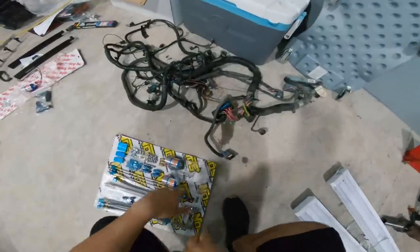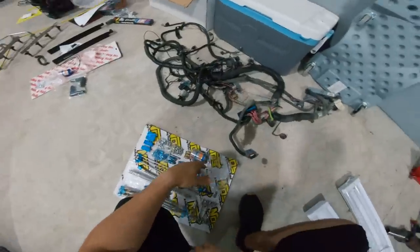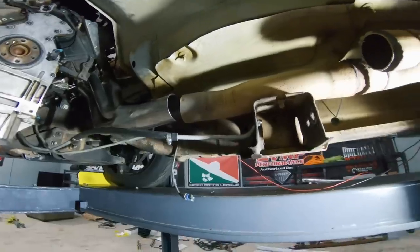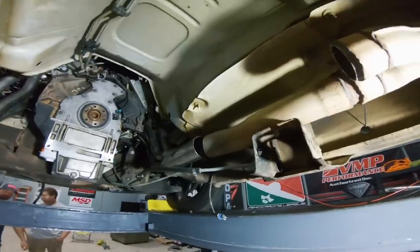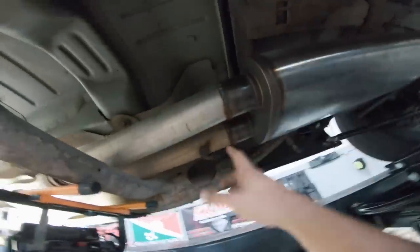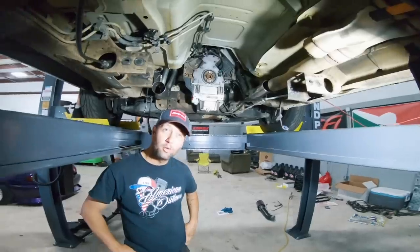Harry also yanked out the entire stock wire harness completely out of the truck. We're waiting on a few more harnesses to come in for the Holley stuff, and once those arrive we'll install the new harness along with the Holley EFI ECU. We'll also need to fab up some exhaust solution, because we've got a Y-pipe coming from the two headers down to a single pipe, but the existing exhaust has two pipes going into the muffler — so we'll probably need another Y-pipe.